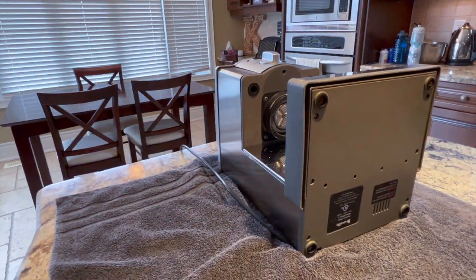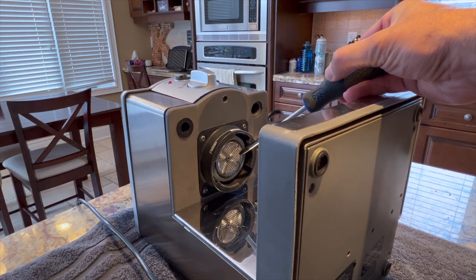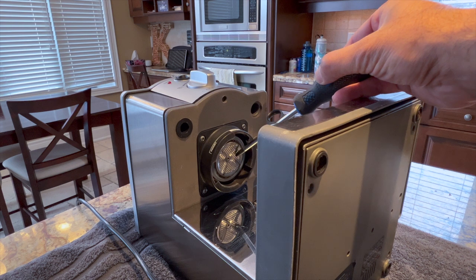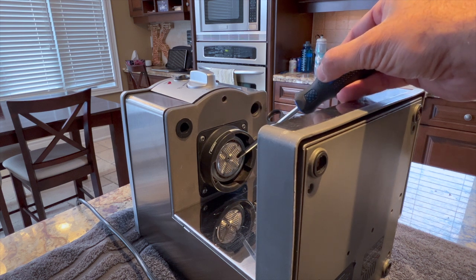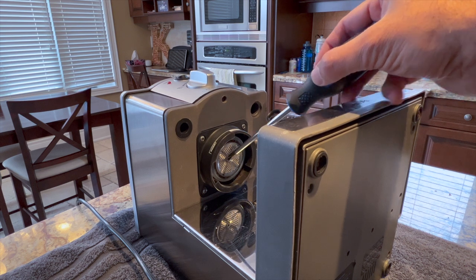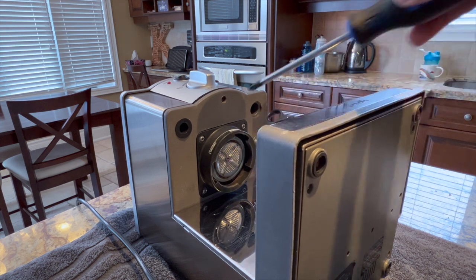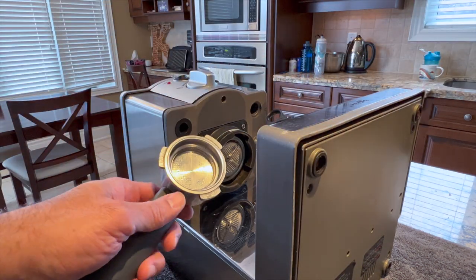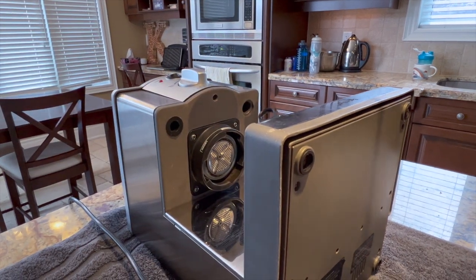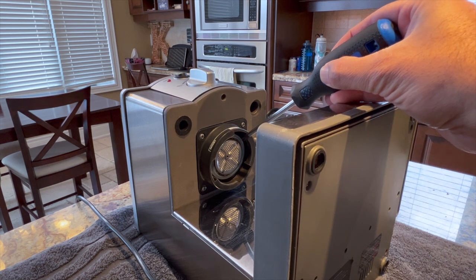There's this little part here that can potentially get clogged, so you'll need to come in here and unscrew this one screw, take this whole thing out and clean it out — make sure the thing is all descaled. But that wasn't the problem for me because I cleaned the heck out of that and nothing happened. One of the problems was this gasket right there — it's a silicone gasket, and that is the part that the portafilter pushes up against as you insert and lock it. If that gasket is broken or cracked anywhere, you will register a pressure loss and have trouble.